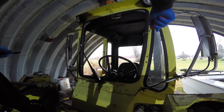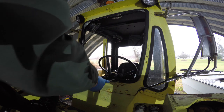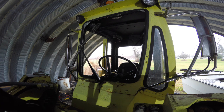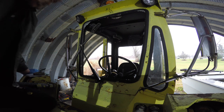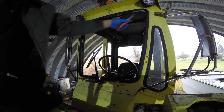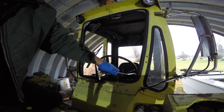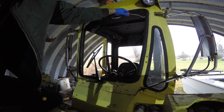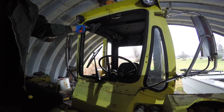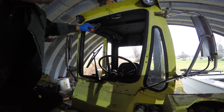So this rubber just unlocked — it's a self-locking rubber is what they call this. So you just take it like that and then you just unlock her. Someone's already unlocked it, to be honest with you. Now we're just going to clean the glass out — it should come out pretty easy, as you see. Now, if you're putting glass back in here, you have to make sure every little tiny piece is out or you'll break the new glass. So I normally take the rubber off and blow them out. But being Lexan, a little piece of glass ain't going to break the Lexan. So if it's not 100% cleaned out, you're good, but you've got to make sure all the big chunks are gone.